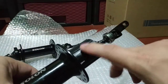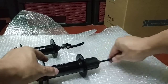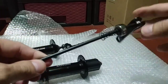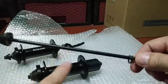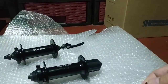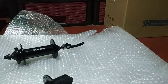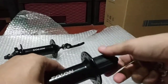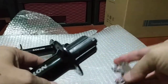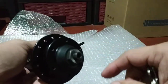The hub freebody is most likely steel — let me remove the screws to show you. Yes, indeed steel. The screws are plain black and also steel — the magnet sticks. Steel is durable but on the heavy side. For fat bikes, which weigh more than 15–20 kilos, steel is definitely the better choice for the freebody and cassette interface.